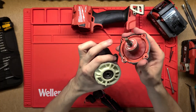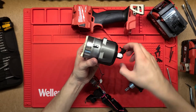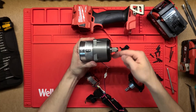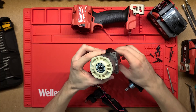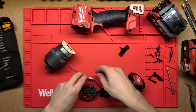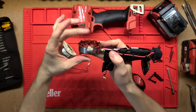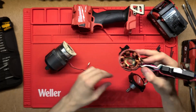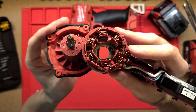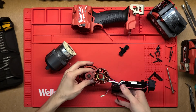There is quite a reduction to it, which makes sense because brushless motors are really good at high speed but not high torque. The point of the gearbox is to step it down and give it actual turning power, and inside there'll also be a couple of little hammers that spin and as they spin they'll hit against a rotating drum — that's where you get the actual hammer action from. It's neat to see a bearing within a bearing there. I'll disconnect it so we can look at the stator separately — it's actually really small, I was expecting it to be bigger. Those permanent magnets are very strong and kind of demonstrate how that assembly goes together.